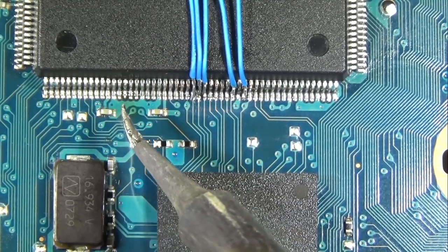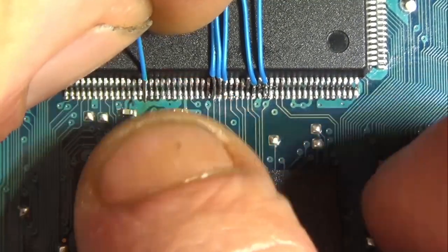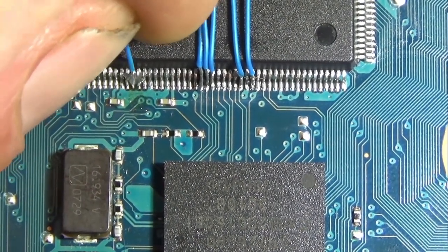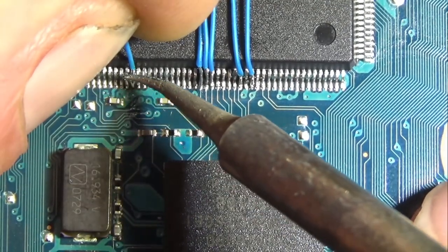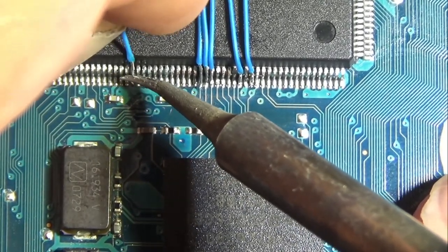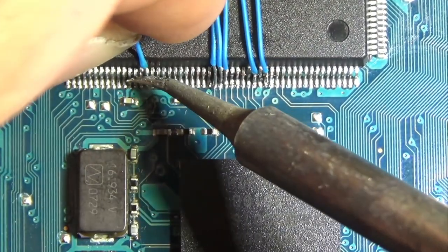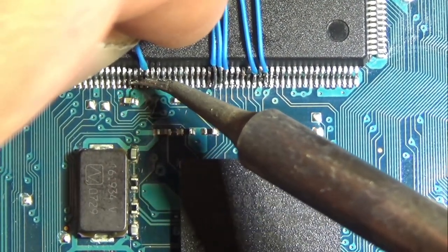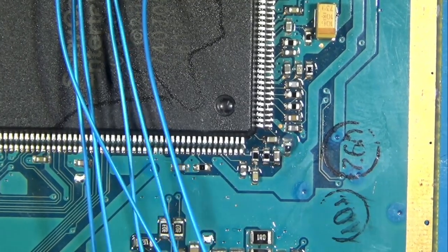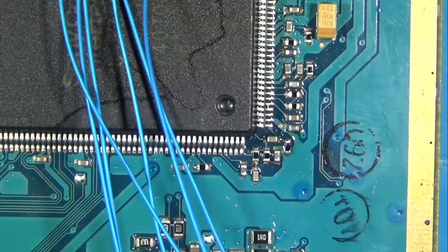This is the Y point — this is responsible for region-free DVD movie playback. Now with the mod chip, it's not region-free in the sense that you can put any disc in and it's going to work. You need to go into the Matrix menu and change the region. So it is region-free, but you do need to manually toggle your region if you're playing a DVD from, let's say, a PAL region. That seems to be the case for most region-free DVD playback — I don't know of anything that automatically switches.